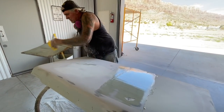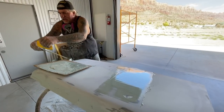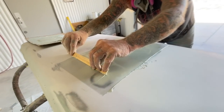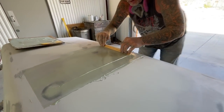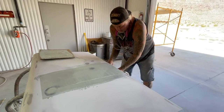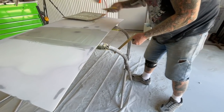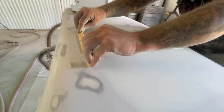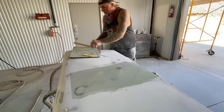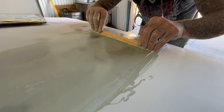Let me get that Bondo off here. So this will self-level, but when you put it on that thick, it's not going to — that's why we're using a stick to help us out. We're going to go ahead and do it again, feather these edges out. We've got plastic on the floor so we're okay. Get our stick cleaned off and do it one more time over here, just like this, using the same amount of pressure. And bam — let me do that one more time right here in the center, following the contour. I can already feel it drying.